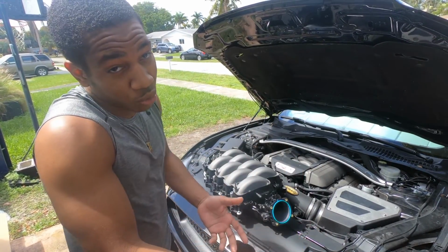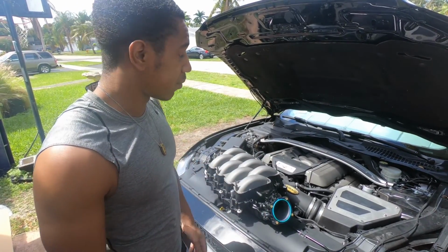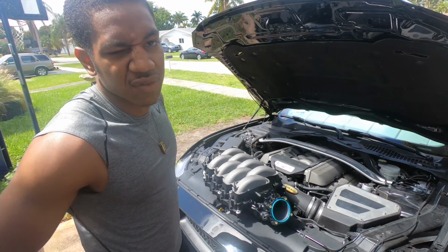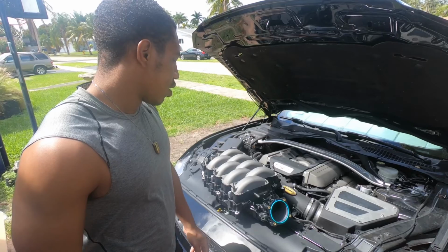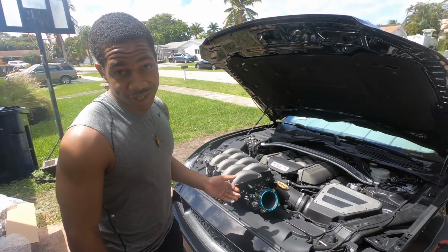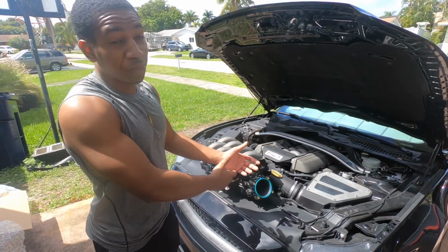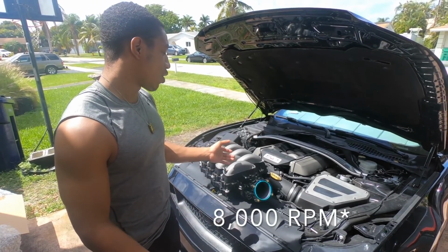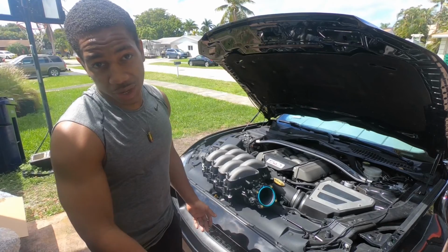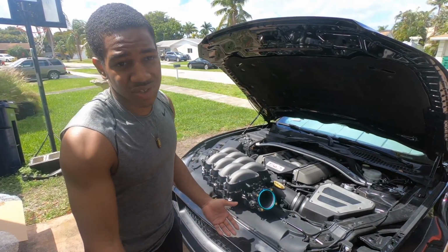We'll only see gains, and we will probably be going to the dyno next video, so you can see the benefits this gave us. The porting is probably going to add another 5 to 7 horsepower over the stock 2018 manifold. Like I said, this manifold carries power up to 7,500 RPM, so with the tune we will be bumping it up to 7,500 RPM. This manifold will accompany heads and cams nicely, because at that point we'll be able to rev it out to at least 8,000, 8,500 plus.